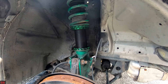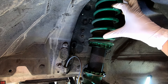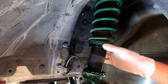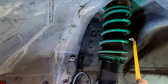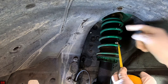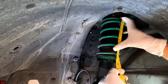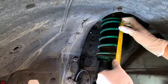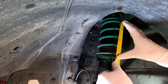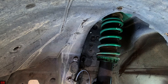This side is 94mm and we'll go to the other side which needs the adjustment. If you're unsure about your preload on your spring — if you believe someone might have played around with it, especially on a used vehicle — you can take your tape measure, find a flat spot at the top here, make sure it's the same on both sides, then measure down to the flat base. That's 180mm, and I've checked the other side and they're both even, so the preload is correct and set from factory.